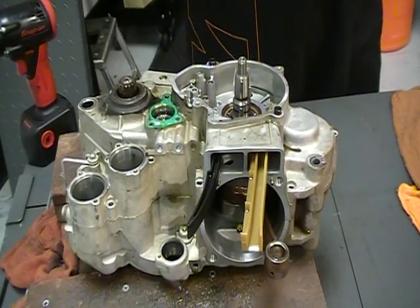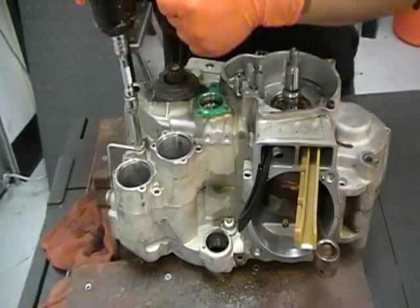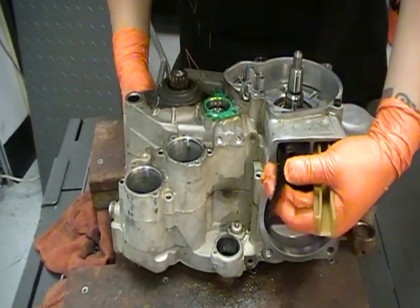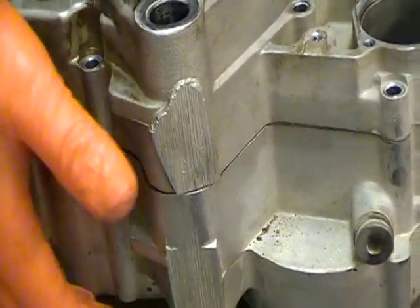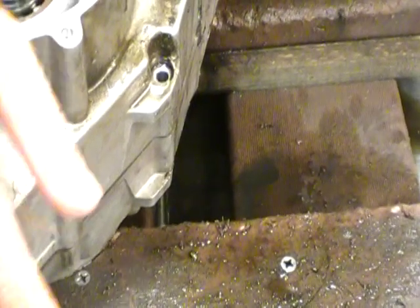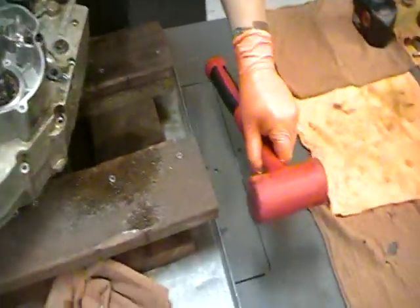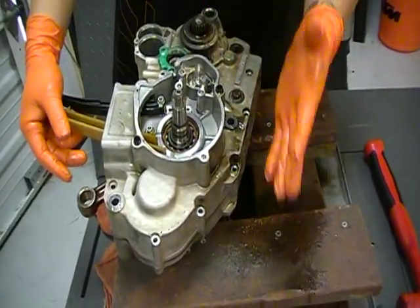Now these cases should separate fairly easy — probably because we're recording they're not going to separate real easy. So we'll give it a try; if not, I'll set up a separation tool and show you how to do that. There are tabs built into the engine that if you want to pound and separate things, you can push on these tabs — there are two there, two here, and two more down on the bottom. That's what I'm going to beat on. I'm not just going to beat on any part of the engine — you risk a chance of breaking something off or damaging it. So if you are going to beat on an engine, first of all, use a dead blow so it's not hard and won't damage anything on impact. Make sure you're pounding on a tab or somewhere that's strong enough to take it.